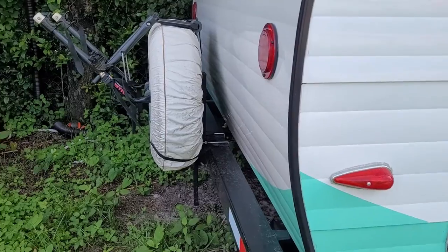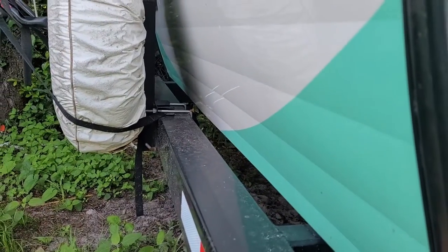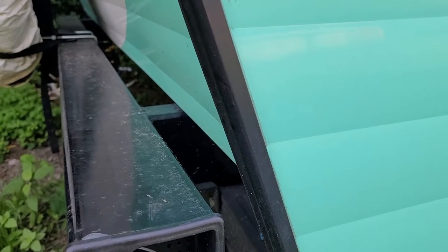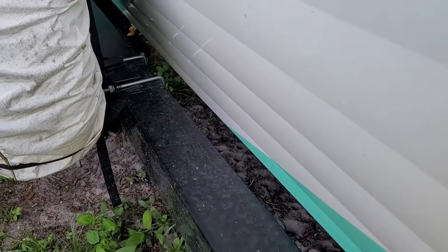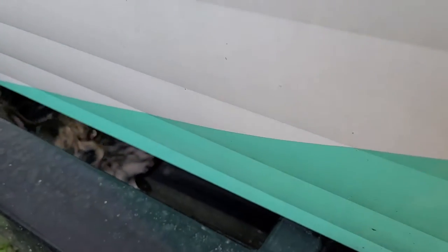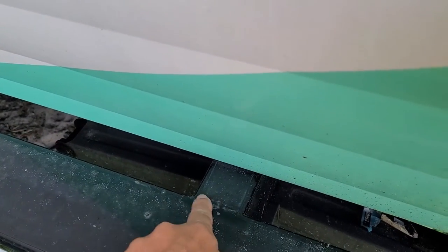Here's my bumper with the tire mounted, just bolted on to the bumper, which is welded to these two mounts. It looks like it's actually part of the frame, but it's only welded right there. Mine isn't separating or anything, but I've seen videos where, after time, when people put heavy items back here, they go back and forth bending, and this weld seam starts to pull apart.